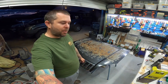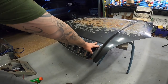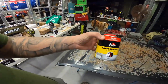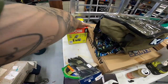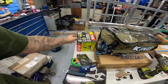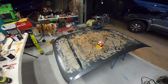Tonight I'm making a start on the black Raptor paint on the bonnet to get rid of this cooked paint. Bonnet's already off, sitting on some trestles. Take these accessories off and then hook into it with some paint stripper to get most of it off, wash it all down, and then get it consistent with an orbital sander. It's a new one I bought — I've got an old one but it's cooked, so I just got another one. Let's do it.